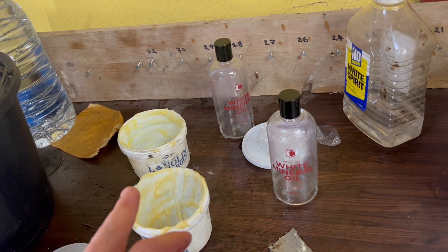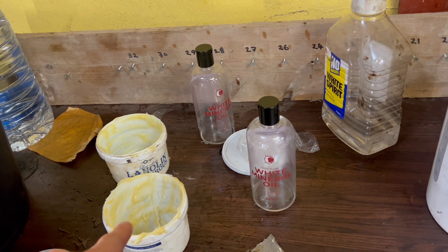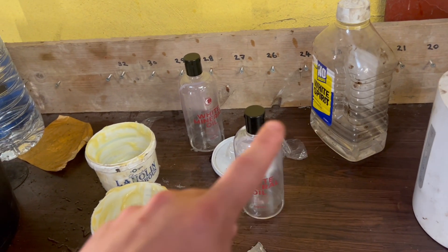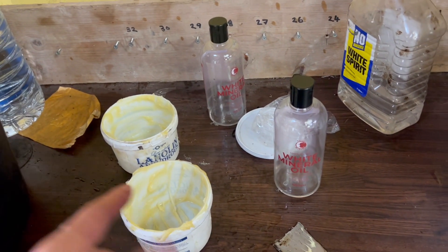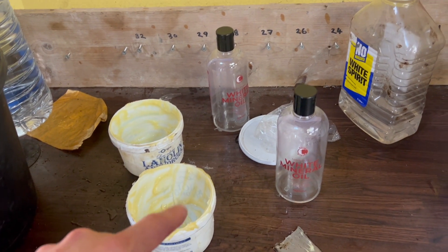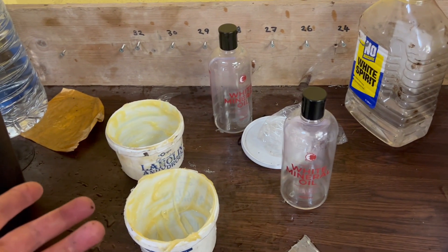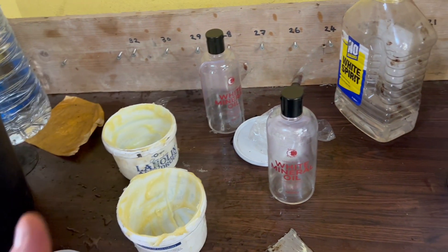To make it, I aim for 25% lanolin blend, which is 500 grams of lanolin, 750 ml of white mineral oil, and up around about 750 ml of white spirit. There's no exact science. The more lanolin in it, the quicker it's going to set and maybe the better it is for rust prevention. But the more lanolin in it, the more difficult it is to spray, so you need to try to get a nice fan out of the sprayer and it takes a little bit of back and forth.